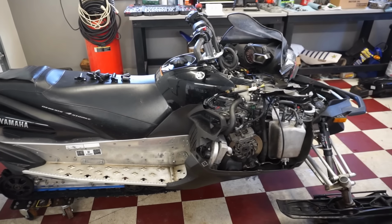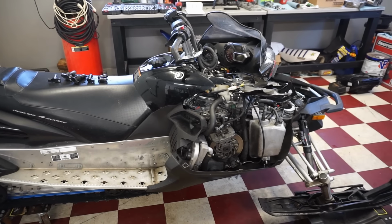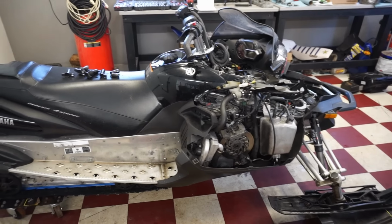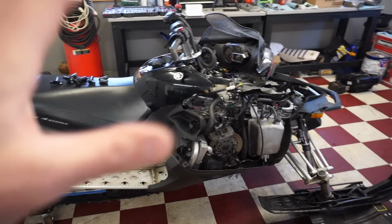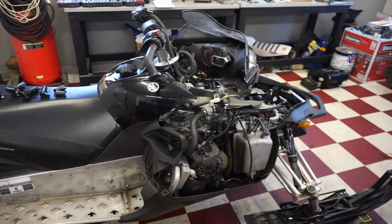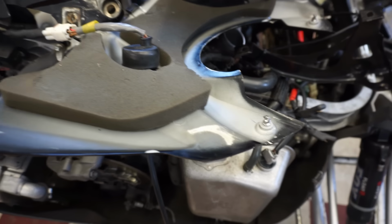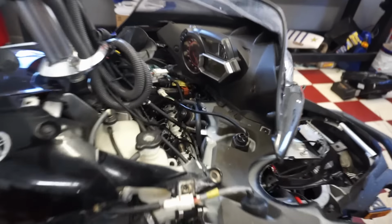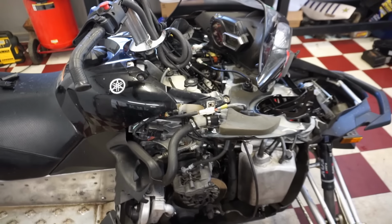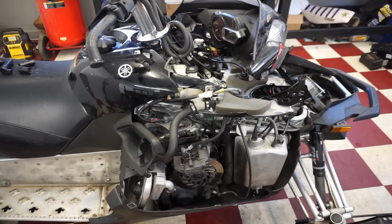We got it for so cheap, $1,200, because the previous owner overheated it, and he said he couldn't get it to fire back up. So what first happened was a stud came off, hit the heat exchanger, the whole sled overheated. He could smell burning, so he took off the oil cap. The dipstick was melted, and then he looked at the crank position sensor because the code popped up on the display here, and he replaced the crank position sensor because that was melted, which was probably throwing off the spark.